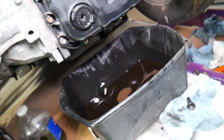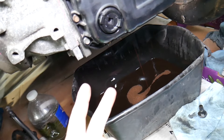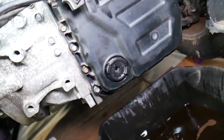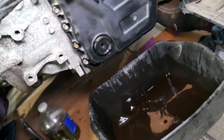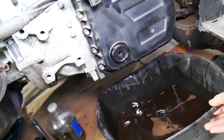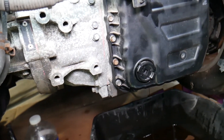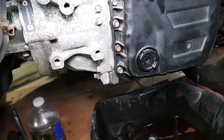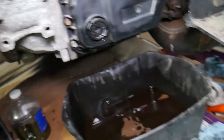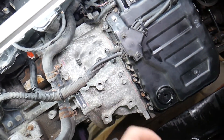What I recommend: put in new fluid, always check the transmission fluid level — don't overfill or underfill. Then drive the car for 100 miles, drain it, and change it again. You may need to do that up to two times to replace about 90 percent of the fluid. Most people think it's a lifetime deal — it's not. We have a special video that explains how often to change the transmission fluid on Jeep Compass, Jeep Renegade, and Dodge Dart.